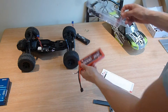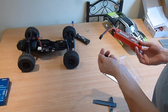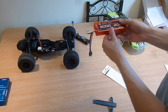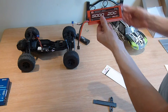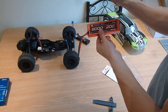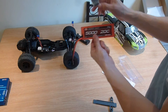For anyone like me who's just buying a battery for the first time and trying to put it in this car, there are a few things you need to know. You can put a LiPo in the car, but apparently there's no low voltage protection to stop the battery going under a certain capacity, which could damage the battery or the car. So it's recommended — along with the battery — to get a little voltage alarm that connects up and beeps when it gets to a certain voltage. I've got it set at around 3.4 or 3.5 volts.